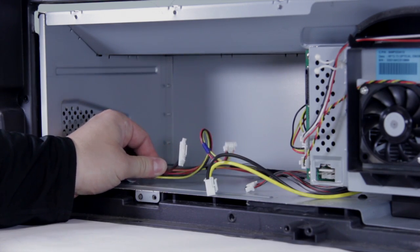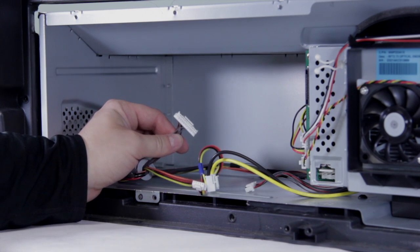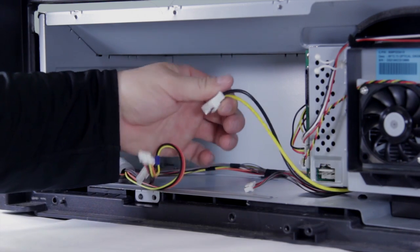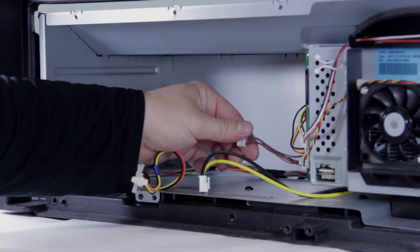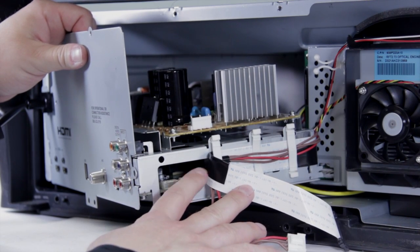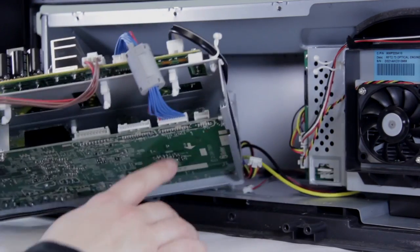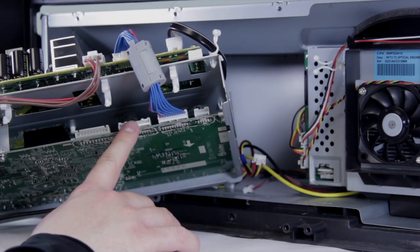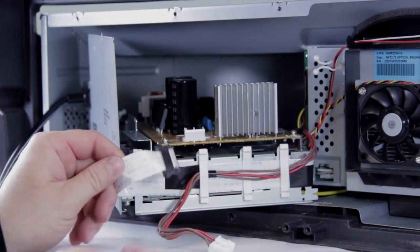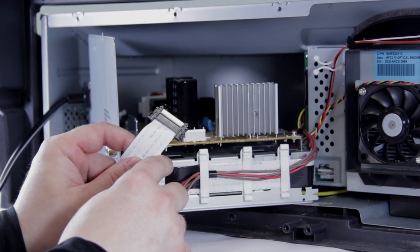We're going to have four connections that we need to hook up from the front of the TV. There's two cables — this one which carries the LEDs and the key presses, and this one which goes to the speakers. We've got a couple of connections here: this one goes over to the ballast, and this one goes to the actuator on the back of the prism that goes up to the lens. On the power supply itself, we have two connections — this one which gives power to the DMD board, and this one which is the video signal from the main board going to the DMD.